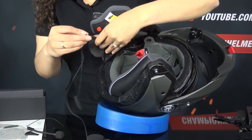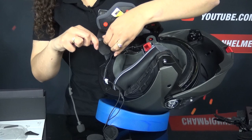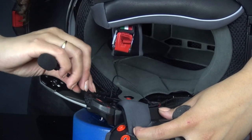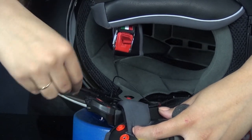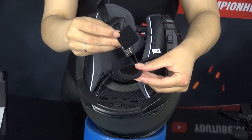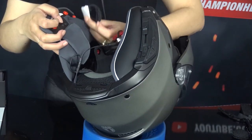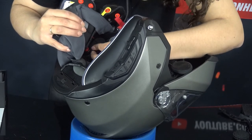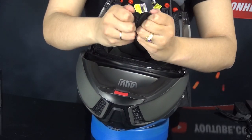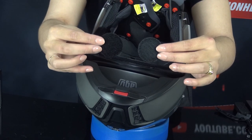After that, you connect the microphone and the speakers to the back unit, and then you click the microphone on the right side of the helmet. This is done in two steps: first you put the microphone in like this, and then you turn it a little bit until it clicks. If the microphone is in place, you put the cable through the specially built-in lock and you can install the speakers. You do this by placing them in the housing using these square adhesive pieces. These velcro boosters are supplied with the inside communication system — you can use them to raise the speakers if the speaker recesses in the helmet are too deep.